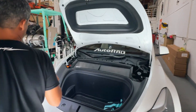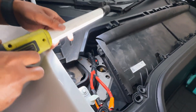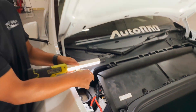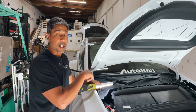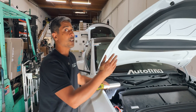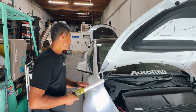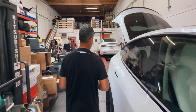On the passenger side, you don't need to remove anything — it's literally right there. Go ahead and turn that one again: clockwise is stiffer, counterclockwise is softer. I always go full stiff until it stops, and then count back to my setting. Even if you're going from 10 to 8 or 10 to 12, I always go back to zero and count back to my softer setting. That way you can make sure the left and right are both symmetrical and consistent.